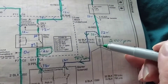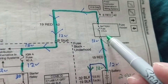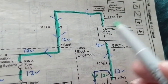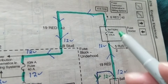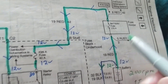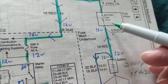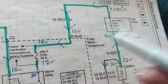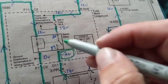The battery goes through a red wire through a fuse rated at 175 amps. This diagram doesn't show all the other circuits — ignition coil, fuel injectors, actuators, solenoids — but whatever goes to the starter circuit cannot exceed 40 amps out of that 175. Once the relay is activated and closed, we should get 12 volts at terminal 87.